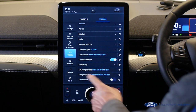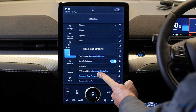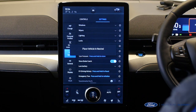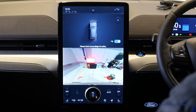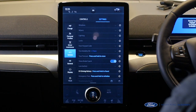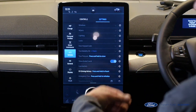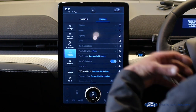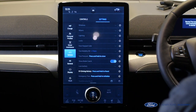We'll close that warning and then press and hold the emergency tow position. The screen says initialization complete. We put our foot on the brake, move the gear shifter to the neutral position, then switch the vehicle off. Now we can tow the vehicle, bearing in mind the maximum distance and maximum speed. Once we get to a charging station we can simply plug in, put some more energy into our battery, and continue our journey.